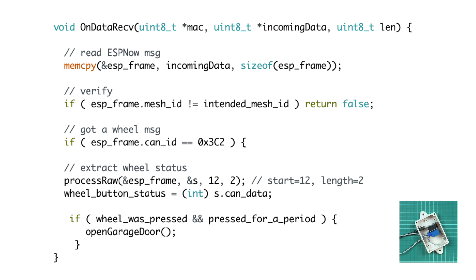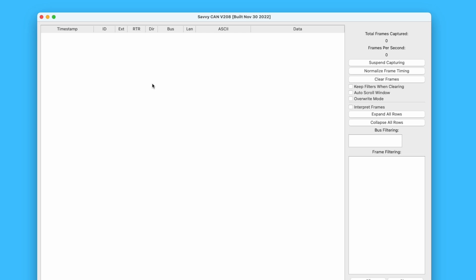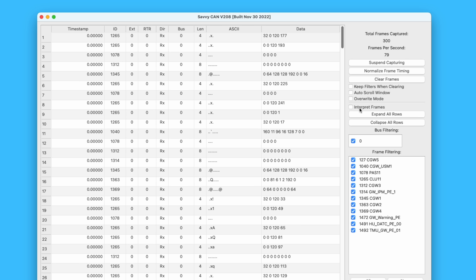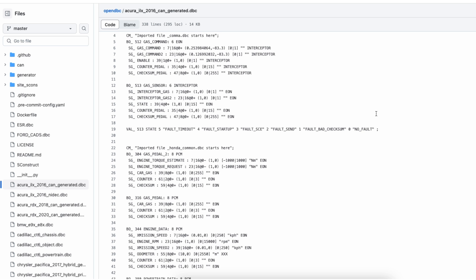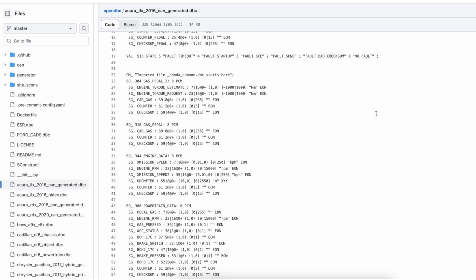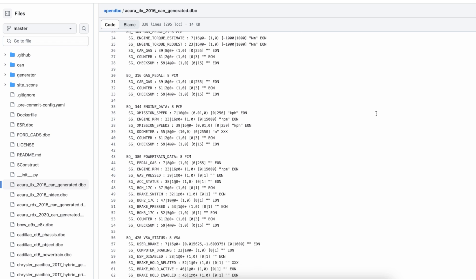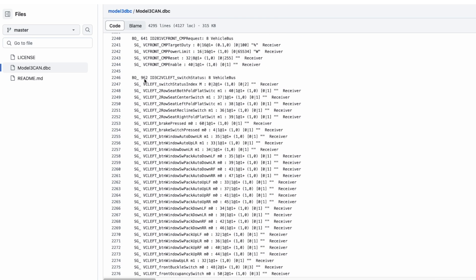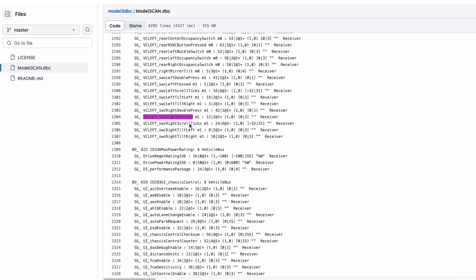Well, this is how the car manufacturer — in my case Tesla — decided to use it. Deciphering the correct message from the CAN bus is typically time-consuming and sometimes car-specific. Fortunately, DBC files, which are like dictionary files, aid in decoding these messages. For my car, I found a partial DBC file on the Tesla owners online forum and through examination I identified the CAN message I needed.